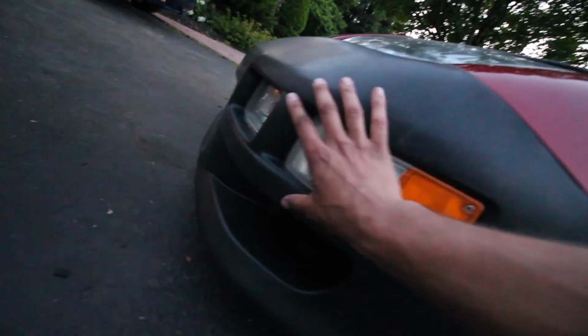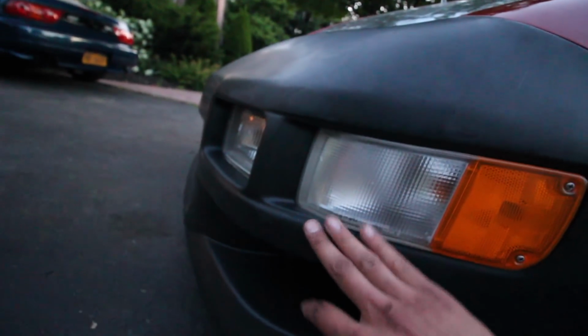One spot that was a little bit strange was this corner light. The other side had no problem, but this one, the actual hole in the bumper, the mold, is too small. Tore up some of the bumper right there, tore up some up at the top. So I'll have to either shave some of the light down, or open up this gap a little bit, definitely, before we go ahead and do anything paint related. This, we'll push that in. Well, I gotta drill the hole out a little bit further so it can scooch in some more. Up here, you know, these are all the big spots I look for. So not bad. It's like 95% on, so I can't really complain about that.